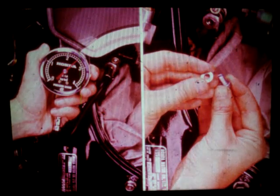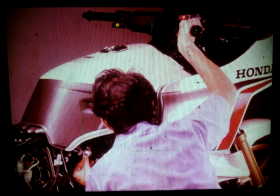Recheck the fuel system pressure anytime the fuel pump or regulator is replaced. And replace the check bolt washer every time you loosen the banjo bolt check plug. Failure to replace the washer could result in a fuel leak. Don't overlook it. If you suspect a faulty injector, check the ECU display.